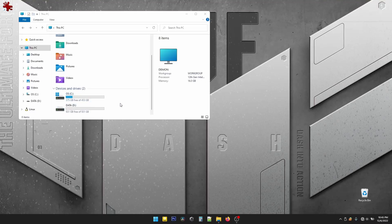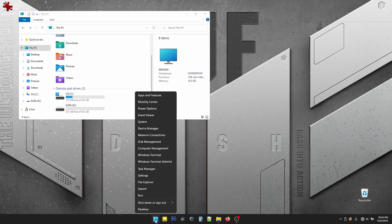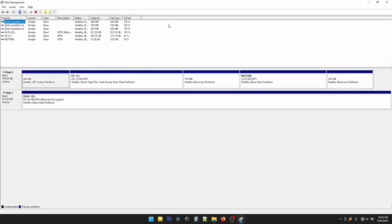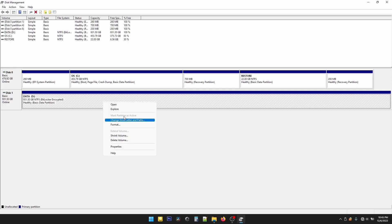If you don't see the drive you can always check Disk Management — right-click on the Windows Start menu and go to Disk Management. It'll show you the drives. It already recognizes my drive because it was formatted before, but if it wasn't, you can come to Disk Management, right-click the drive, and delete the volume, extend the volume, or format it to a Windows format — whatever you need to do.